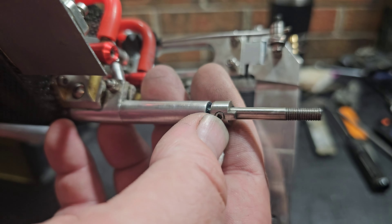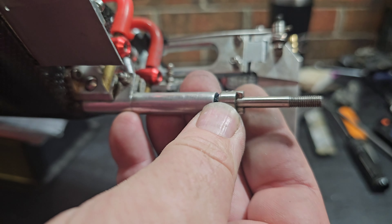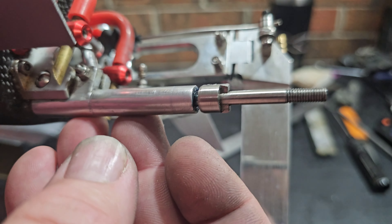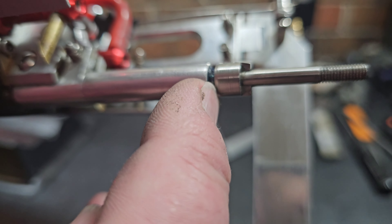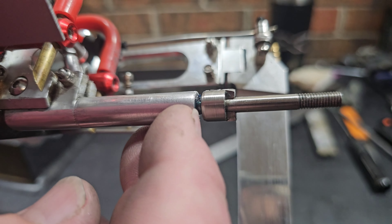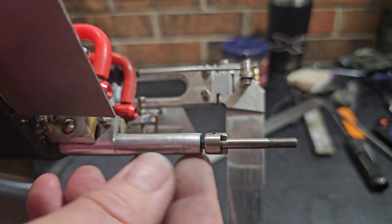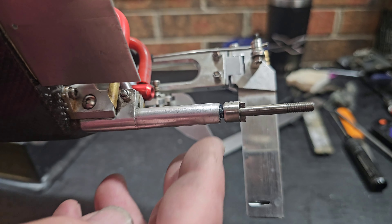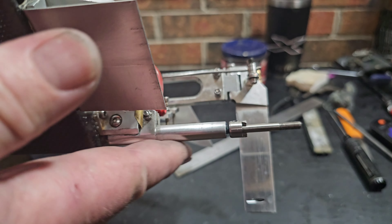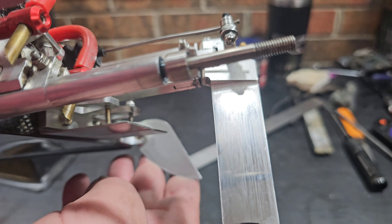For speed, I always make sure my grub screw is flush with the drive dog and not protruding past it — I feel that's pretty important. Also, I like rounding the front of your drive dog, even if you have a thrust washer. Any sharp edges sticking past the stinger will just slow you down. Make sure everything's nice and smooth for water to travel across.